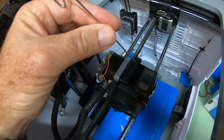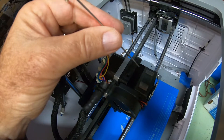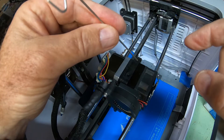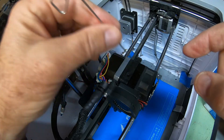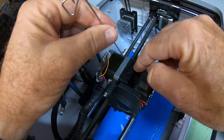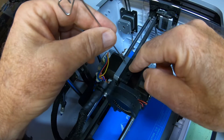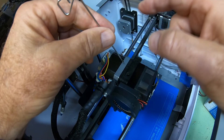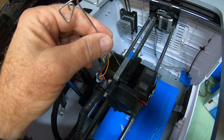That's my procedure for switching between PETG and PLA. I do the same thing in reverse: when going to PETG, first clean the print head, run the cleaning filament using the lower temperature (225), then go to 237 and run it through at that temperature, clean it out, and then you're ready for PETG. So do it in both directions whenever you're switching filament type.